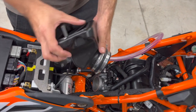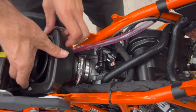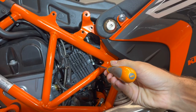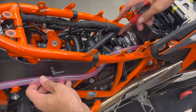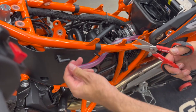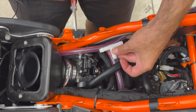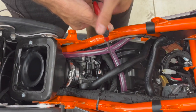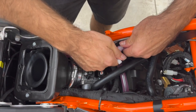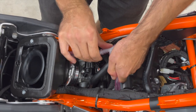Connect the heat sensor. Then above the cylinder head insert the tube like this. Now we are ready to put the airbox on the intake like this — center it — and then from the left side secure the sleeve. Prepare it, measure and cut it, then insert it immediately. Now we need to connect the engine breathing. We cut it here more or less in between. Use a little bit of grease on the tee — it makes insertion easier. And it's done.